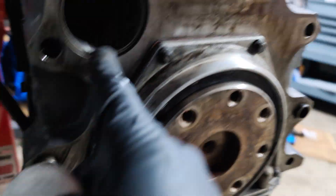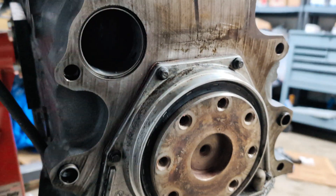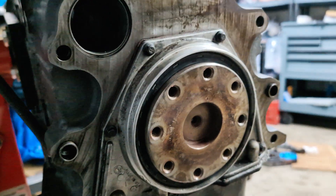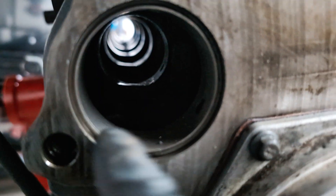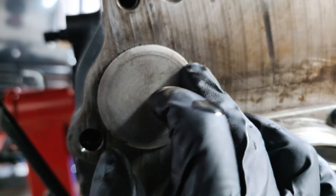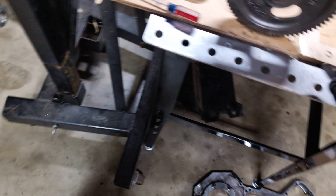On the backside of this engine, you have a plug that goes on the backside of the cam. If you're doing a rear main, or a transmission swap and you're already back there — this is right behind the adapter plate — check it out. Make sure it's not weeping, because when I did my transmission swap I didn't check that and I didn't even know to check it. If that's leaking, you're going to get all kinds of oil buildup on the backside of the engine. The way this plug works is an O-ring goes in this groove, then the cam plug goes right in. You hit the center of it with a hammer and it distorts and pushes out — that's how it seals. This thing is like $7, not very much money, but worth paying attention to.